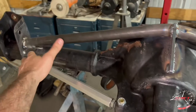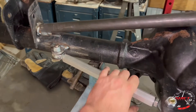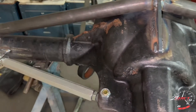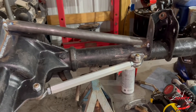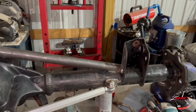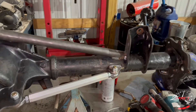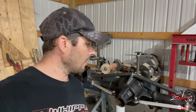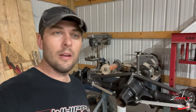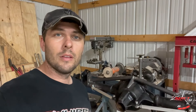This is upside down right now — this is for bracing so you don't do a watermelon-shape axle on the launch, because all the weight will be pushed on this. I'm going to call it quits right here, but this is how you brace your axle. The next step will probably be cutting the stock location brackets and welding on the Racecraft relocation brackets so I can run the bars lower. It's like midnight, I have somewhat of an axle put together, and in the next video I'll have the relocation brackets fabbed on there. Thanks for watching.